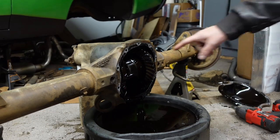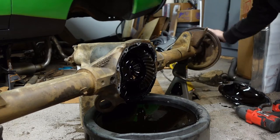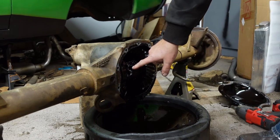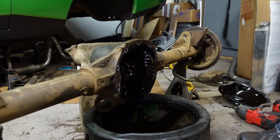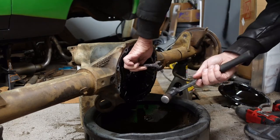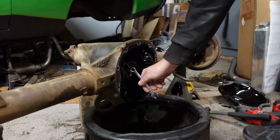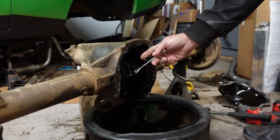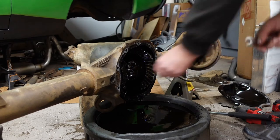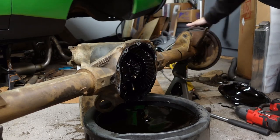The next thing now — I've got to get the pin out of the center here. There she is right there. So this bolt right here I need to get out — it holds this cross pin in here and that's what holds this whole works. Give it some love taps. Come on, oh yeah, not terribly tight. I imagine you'd use some thread locker on that. Won't matter because I'm getting a different differential — I decided to go with the posi, I think I already mentioned that in the last video. She's definitely not holding that pin in anymore. Look at that, the pin just comes out — just gave her a little push is all.